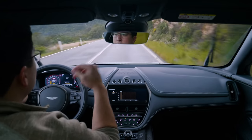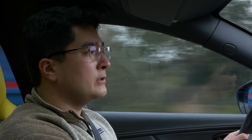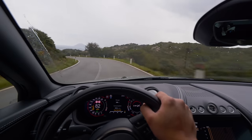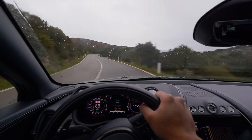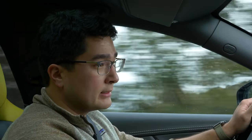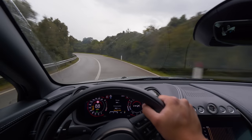The other thing I really like about this car when you're driving it like a sports car — which is what this thing is supposed to feel like, an SUV with the dynamics of a dedicated sports car — is the front end. Unlike a BMW, the front end, despite being very quick to turn in, doesn't feel entirely unnatural. The way this car uses its double wishbone front end: you get into a corner, it takes a second to set, the car gains some dynamic camber, and then it just pulls its way through. The front end loads up like a sports car. The steering doesn't have a weird ramp-up effect like an X5M or X3M, but it is fairly dead — though it is linear.